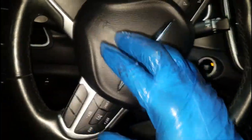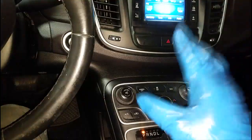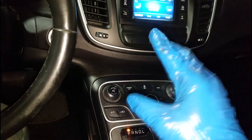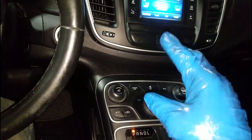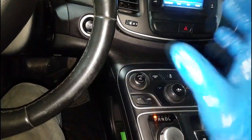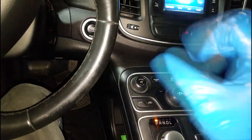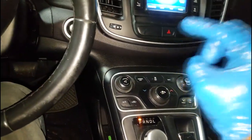What I'm going to do is verify the complaint visually. I do not want to run the car or let it idle. I'll rely on my eyesight to do a thorough visual inspection. In some cases when chasing a cooling leak, you should also pressurize the cooling system using a cooling pressure tester. Wherever the weakest point is, the leak will come from there.